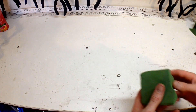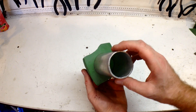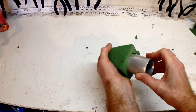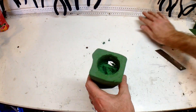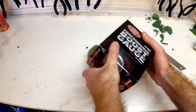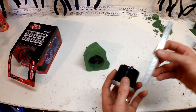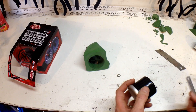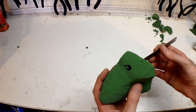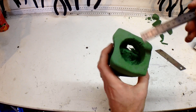Alright, so I've sort of got a basic shape now. I'm going to make the hole for the gauge. Now this is a bit of 2 inch pipe, same size as the gauge, so I'm going to start making the hole. Now it's looking pretty good in the car. I'm going to try the gauge — this is the gauge I plan to use. I'm going to check it for depth. We need at least 45mm depth, which is a lot more than what we've got at the moment, so I need to keep milling.